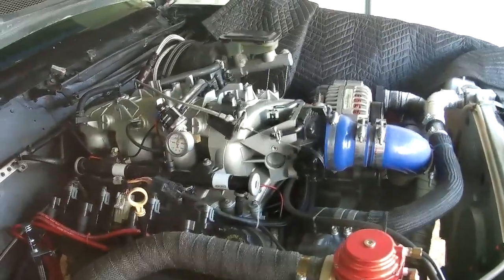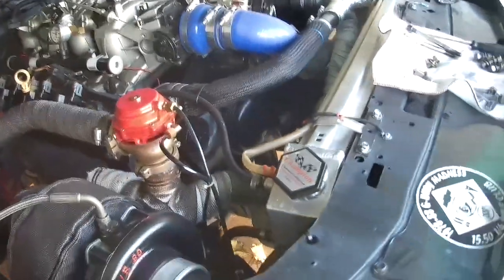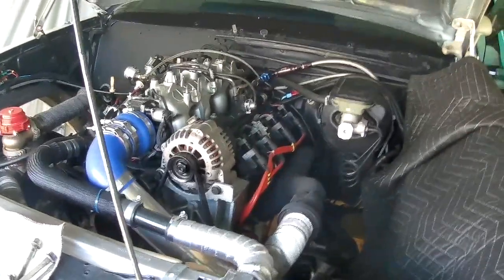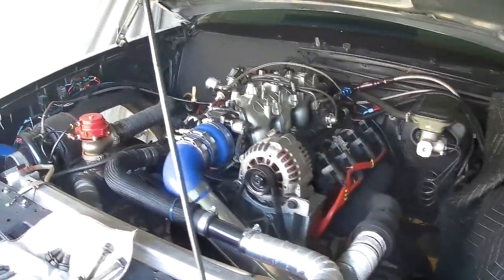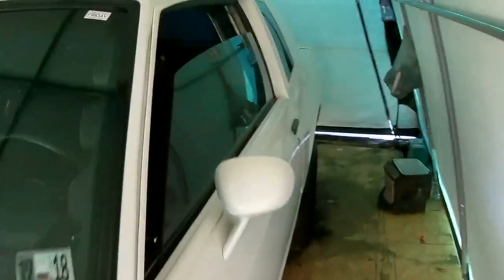As far as the rear end, it has a TH400 trans in it, but it's got an 8.5 10 bolt out of a Grand National in it. 3.42 gears, C-clip eliminators, got a mini spool in it, and depending upon the trans brake and how this thing leaves, that might get upgraded too. I'll be that guy that's sitting there with literally his rear end all over the track.